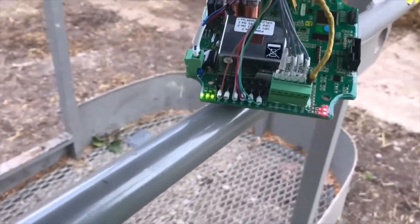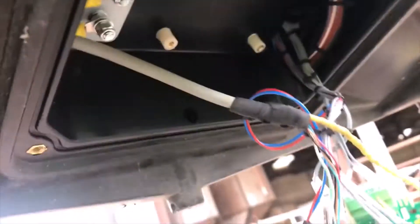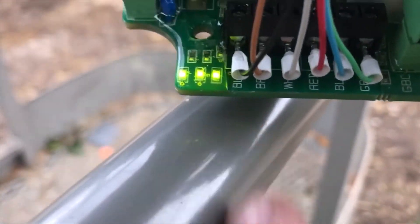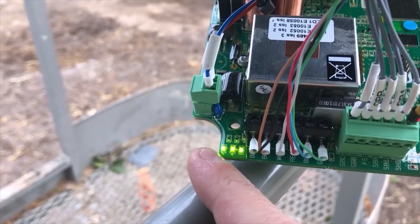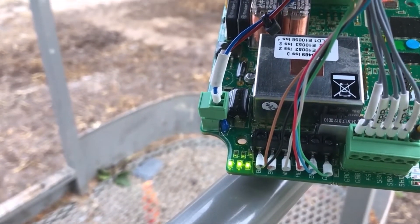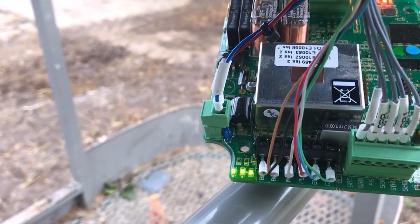So machine is on now. I have this board hanging down here - I remove the old board and I will replace it. If I can show you what we have here: I have three LEDs on. Those three LEDs are showing the power supply to the board. So the top one is showing the 12 volts, the middle one showing the 5 volt rail is okay, and the bottom one showing the 3.3 volt rail is okay. So when the board is operational you have to have all those three LEDs on.